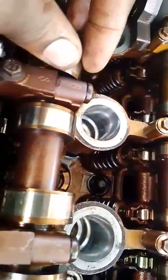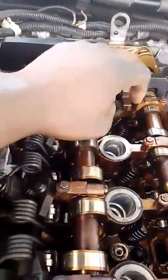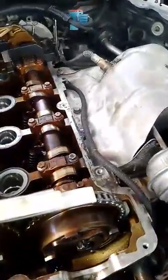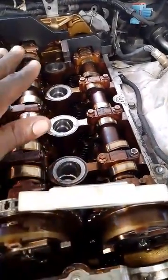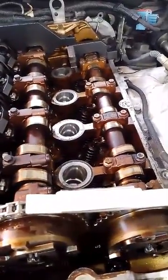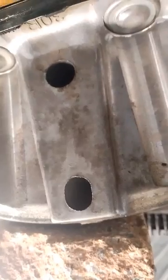Those marks must be on top. So once these three things are on top, these marks are on top, then you lock the camshaft with the timing tools. Then you have to put all the pistons in the cylinders - they must be on the same level. There's a place where we lock the crankshaft from underneath, let me show you.